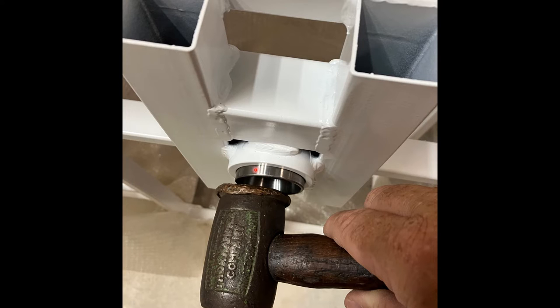Here we are tapping the ring of the roller bearing into the frame. It's important to use a very soft hammer for this — I would suggest using a piece of wood to tap it in, or you can use a bearing puller if you have access to one. When the ring is inserted it's tapered, so it'll only go in one way and work properly. The thin end of the taper points to the outside, and the thick end points to the inside of the fitting. If you get that wrong, you'll have to tap it out and put it in the other way.